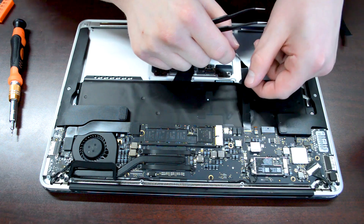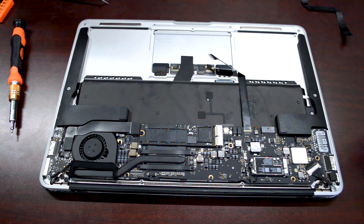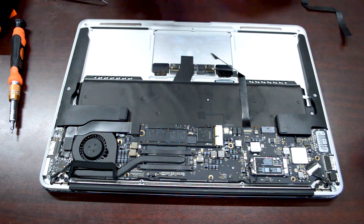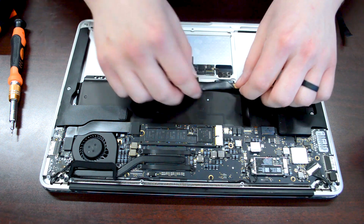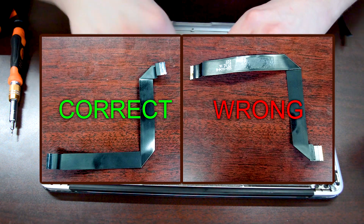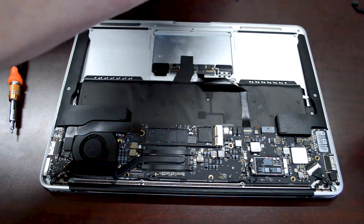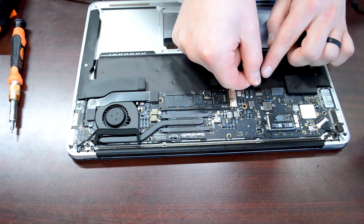Insert the new cable using the same method — push the cable in and push down the tab. Sometimes these come pre-folded, sometimes not. You can add adhesive to have it stick down neatly. Now, huge step here: there is a wrong way and a right way to put the cable in. Make sure the copper side is facing down — I actually put it in incorrectly the first time. Flip the cable around so the black side is facing up when inserting.